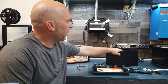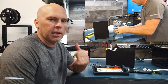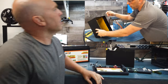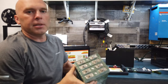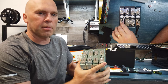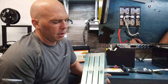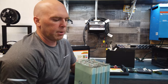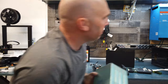I'm not going to tear open the cells on the battery here because I've done that before in a previous video, which I will link to below. I actually took the cells out and ripped them apart — they look a lot like these. These are the cells inside: they've got bus bars on them, and the leads coming off of those go into the BMS. Four aluminum case prismatic cells, 3.2 volts each, lithium iron phosphate — that's what's sitting inside, and that's what the brace bar is holding down.